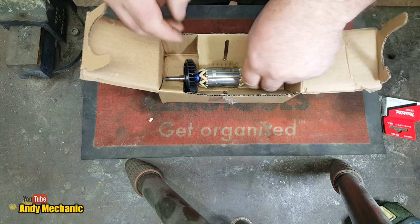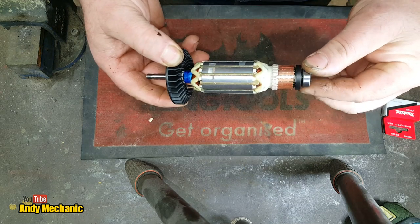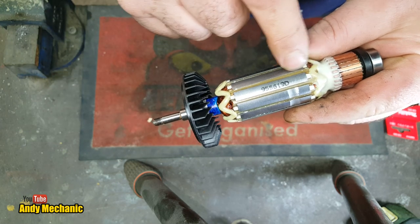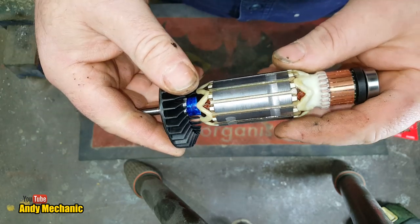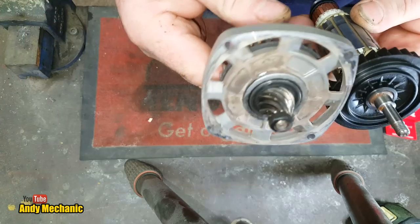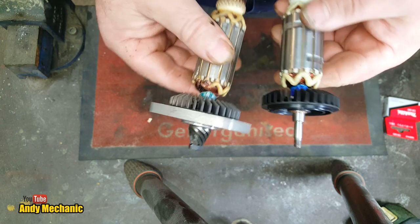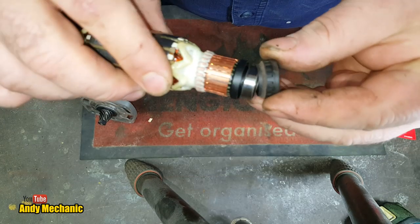You can see where that's probably an anti-vibration compound in there - it's not an insulator, it just holds the windings in place, almost like a glue. And you'll see these little grooves here that have been cut out - that's to do with balancing the armature once it's been made, to cut down on vibration. Now, the pinion's missing, so we need to swap that across from the old one. It does come with the fan as well, which is great - slightly different design, a little bit thinner blades, but that doesn't matter. We've also got this vibration sheath to swap across onto that bearing there. Well, that was quick.